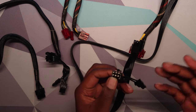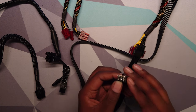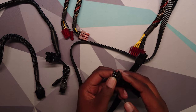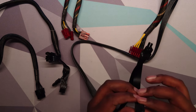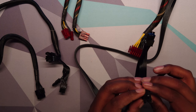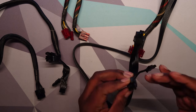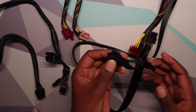In reality, you can use them for a lot more power because manufacturers like to stay safe with these numbers. Every company that uses these connectors will use them in varying scenarios — old cables, new cables. The weak part about these cables is that the connection is the weakest part. If you have a bad connection or maybe not enough wetting current, you can have a lot of resistance. It will heat up, melt plastic, and cause even more resistance — that is the biggest issue with these cables.